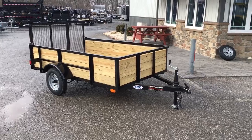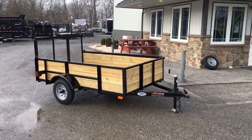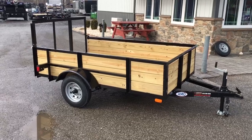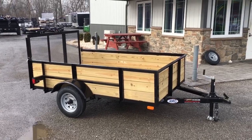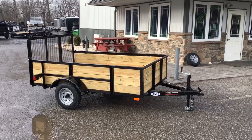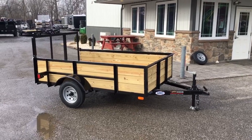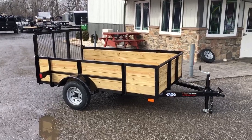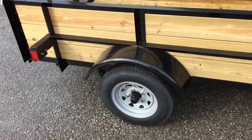Another feature on AMO — again, it is our entry-level trailer, so buy accordingly. However, they're using a urethane paint on this trailer. Most of your cheaper trailers in the marketplace are going to be acrylic enamel. Urethane's got some hardener in it. Generally, acrylic would be on your lower-end type trailers, and then your big manufacturers generally are going to powder coat. Urethane's not normally used on a trailer at this price point — that would be more on your Korn Pro and Moritz, your livestock trailers that are trying to give you a superior paint finish. So again, a little detail for a trailer at this price point you wouldn't normally see.